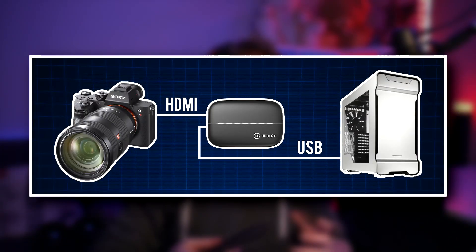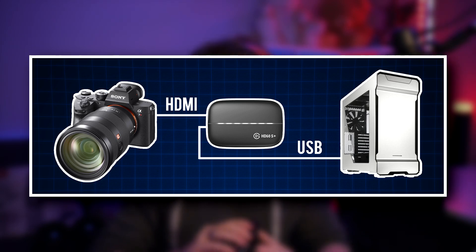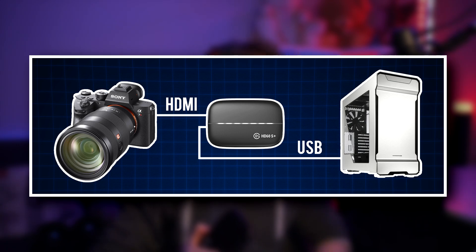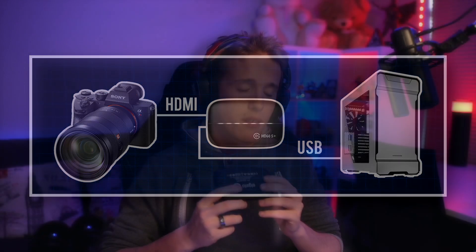I was actually using this one to connect my webcam before I got an internal one, and they're incredibly easy to set up. On the screen right now I've got a very basic diagram showing you exactly what to do. All you're really doing is connecting the HDMI port of your camera to the HDMI port on your Elgato HD60S Plus, then connecting the USB cord that comes with the product to your computer. You may be asking why it has two ports — one that says 'in' and one that says 'out'. That's because it's a capture card; it can still display whatever you're playing on your TV. But since we're just getting the feed from the camera to your computer, we don't need to worry about the other port at all.